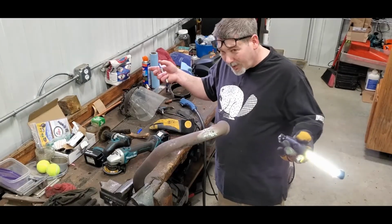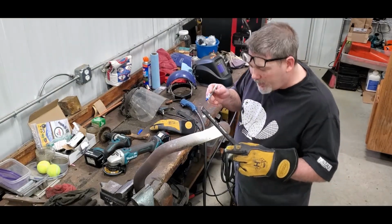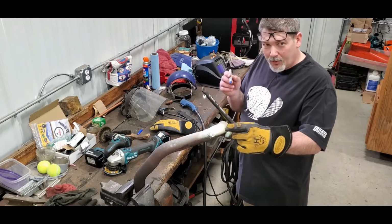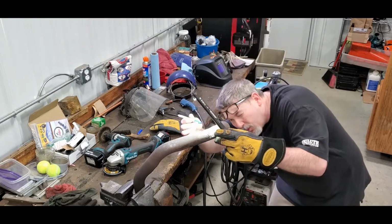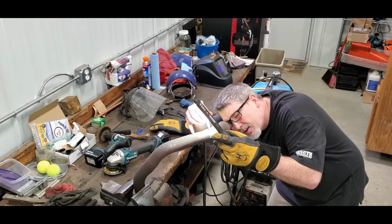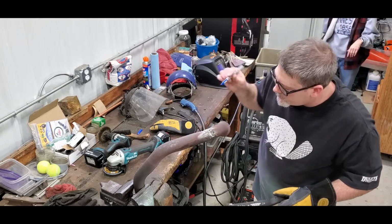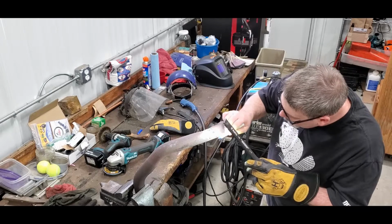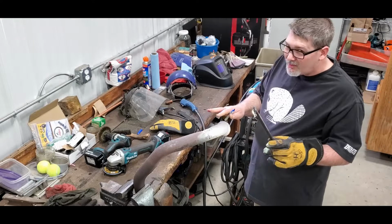And remembering that grinding is a part of welding when you suck at welding, I think I've welded one pinhole in. So when I look through here, I can see a teeny hole. So what I'm going to do to locate it is, when I hit it with the Sharpie, it'll go away. And then I'll know exactly, oh yeah, and don't forget, it's very hot. It is right there. Yep, so I've got a piece of slag right there. I will weld that in. Do one more grind, and as long as the collar slides over it, we're not going to get too crazy on the grinding.